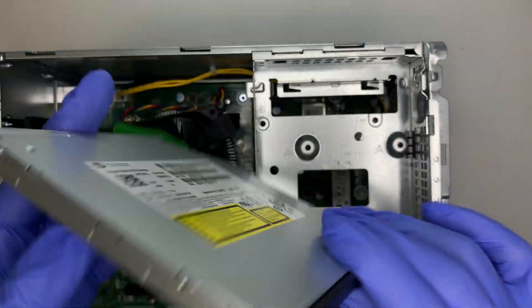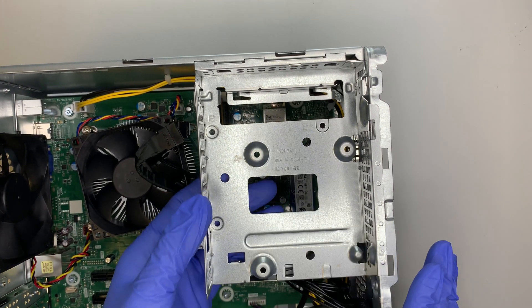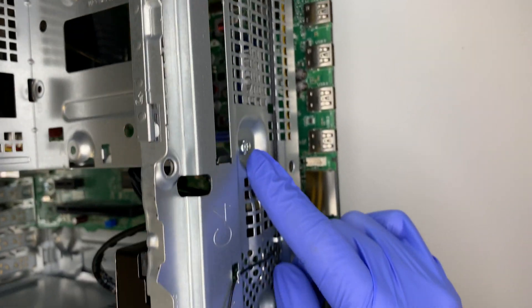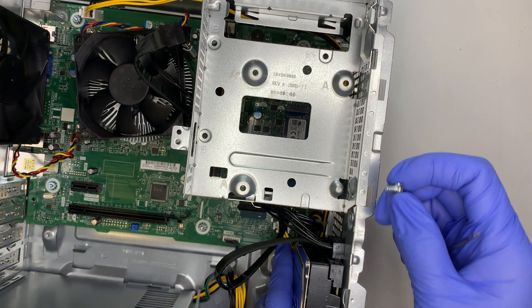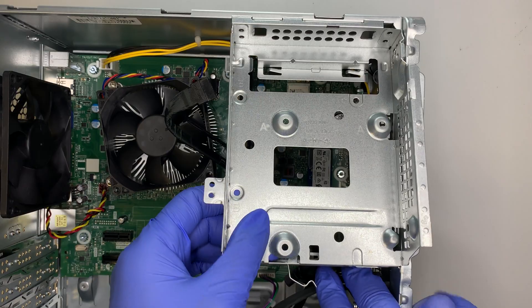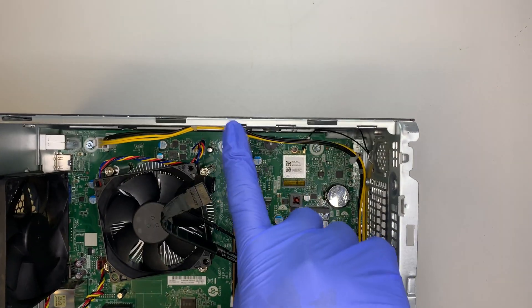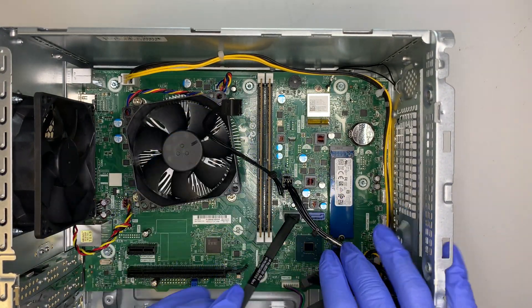This is manufactured June 2020 and is an HP optical drive. Now let's put the optical drive aside. To further explain the internals, I need to remove the optical drive bay that holds the CD drive. There's one screw in the front holding the bay - remove that, make sure the cable is detached from the clip, then lift the bay straight up. It has three sliding tabs that fit into three slots, so just lift it up and it comes right out.